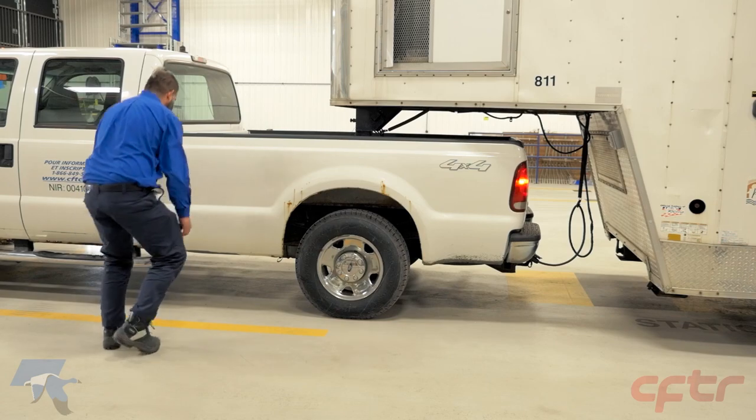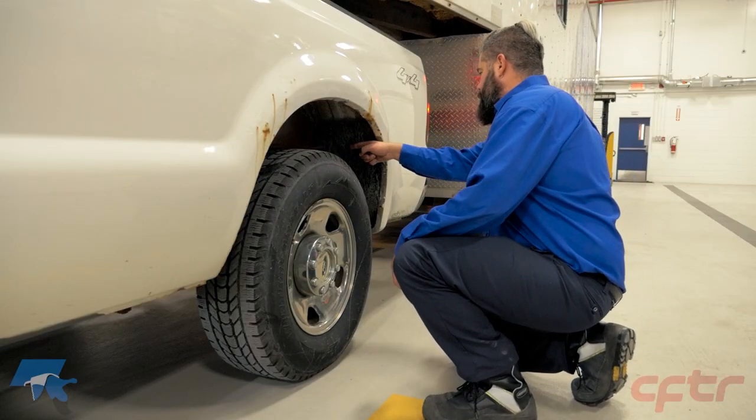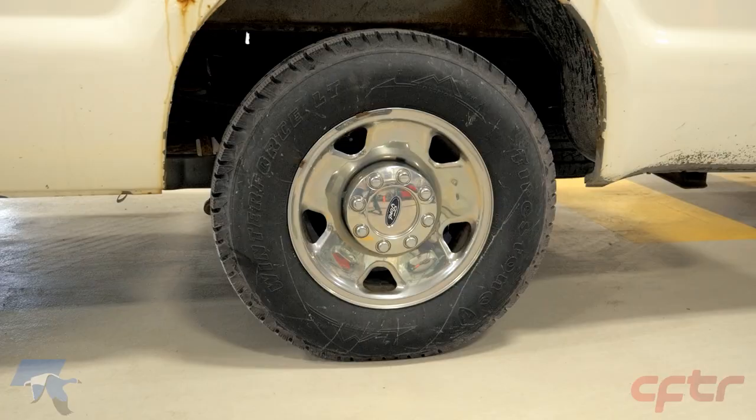At the back of the truck, inspect the fixed components of the body and the suspension. Check the position and condition of the leaf springs, coil springs, and torsion bars. Inspect the general condition of the tires, including wear, damage, and presence of foreign material. If a tire touches a fixed component of the vehicle, shows an air leak or is flat, or shows a deformation or bulge related to a carcass defect, note the defect. Also inspect the condition of the valves.